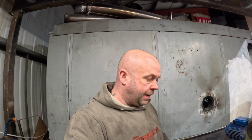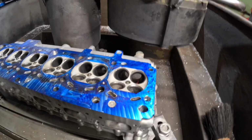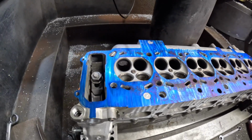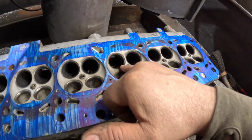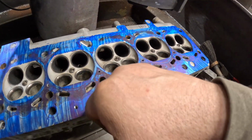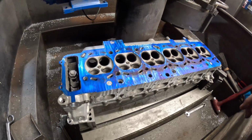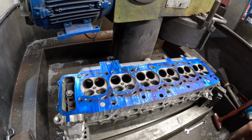I've been doing a BMW M3 cylinder head and bottom end for a customer, and this is the cylinder head, which is in for a reface and seats cut. It also needed 4 valves because it's had something detonate away in here, and it's bent a couple of valves. There's some bits below this pen that we've put on. I've covered it in pen because it's quite well warped, so I thought I would show how bad it was.